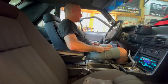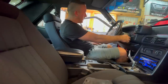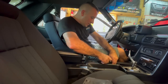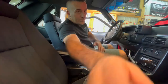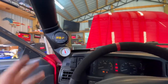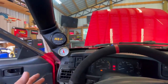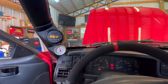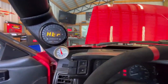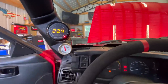Okay, that should be long enough — just to make sure, because it feels like an eternity sitting here in this hot car. Okay, off. Now all you've got to do is plug your new sensor up. Make sure it's snapped in good. Go ahead and switch the key on. This takes up to 20 to 30 seconds the first time. Make sure your sensor is in free air — it doesn't need to be in the pipe. You're calibrating the sensor at this point. Trust me, it will calibrate. There it is. And that's how you calibrate it.